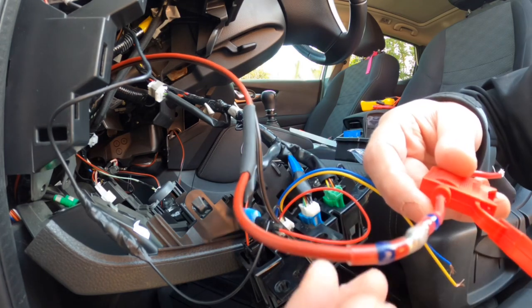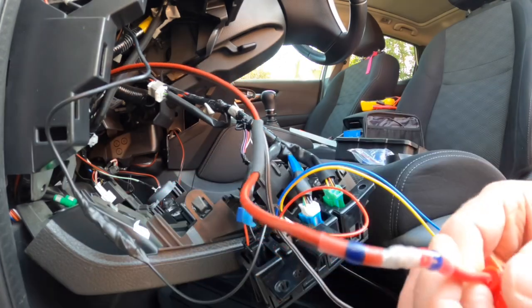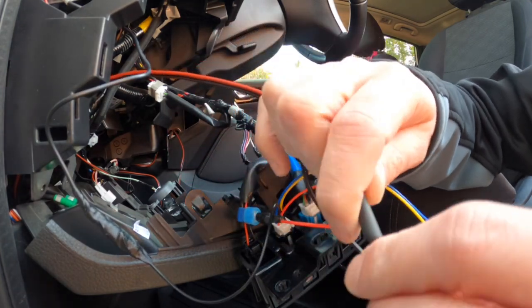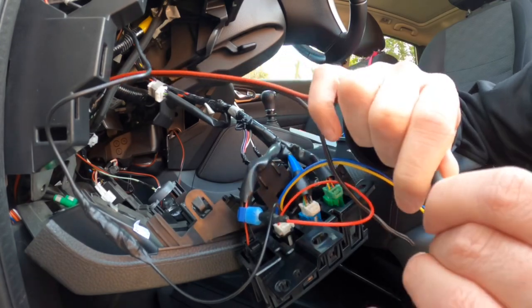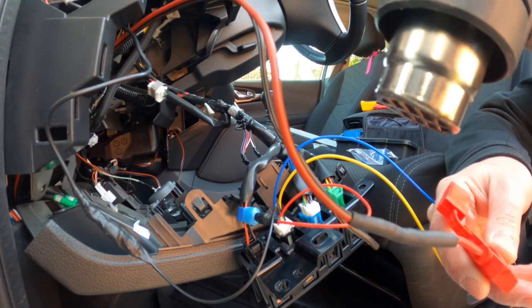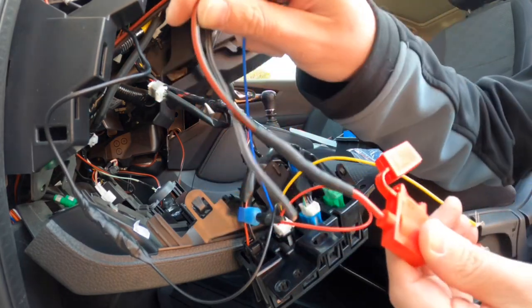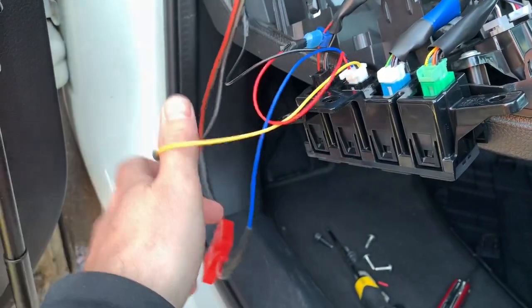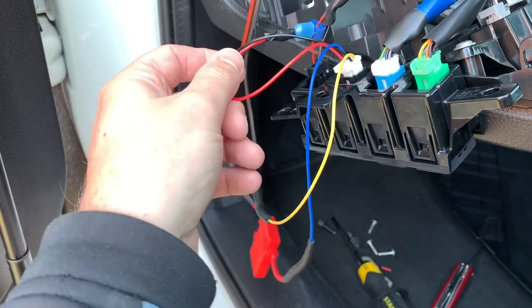As you can see, this was isolated and soldered at the same time — really neat. You can slide an extra isolation sleeve around if you want, it isn't really necessary but you can. So from the toggle switch: blue is the incoming signal from the accessory, yellow is the outgoing. The red one is connected to the neighbor switch and the black one is connected to the ground.